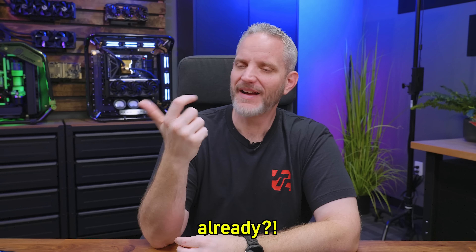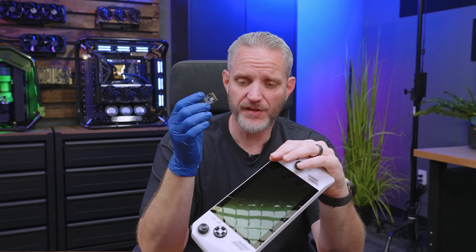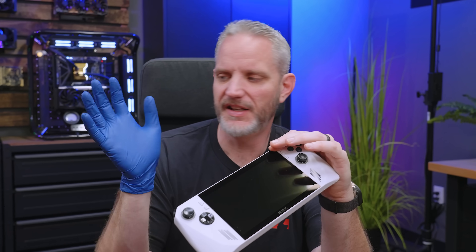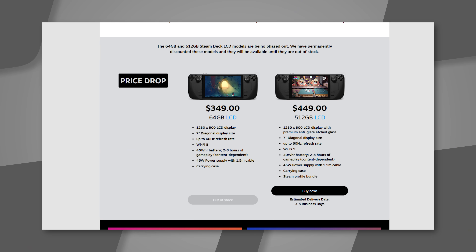He's coming from a one terabyte to a two terabyte. The Steam Deck also uses 2230, and it came with like a 64 gig almost bare-bones version where it was intended for you to throw your own storage in there. It was EMMC type storage — nothing good. It was like trying to run an OS off of a micro SD card. So obviously you wouldn't want to do that, which is why this kind of upgrade appeals to a lot of people.